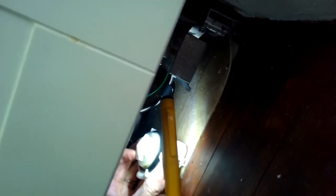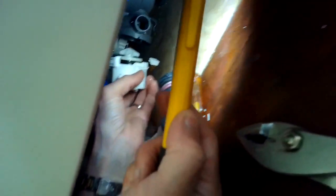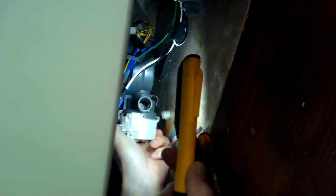I'm just going to check the impeller — looks okay. Looks like something was rubbing against it but it spins fine. When I look in there I found a glass shard. So this was the problem — a piece of maybe a bowl or a wine glass that got pulled into the drain system. It was rubbing against the impeller and blocking the path of the water. The impeller and the motor look good, so I'm just going to put them back in.